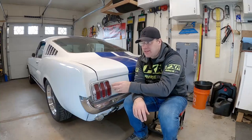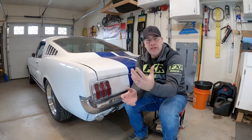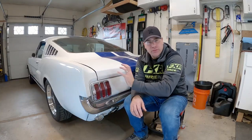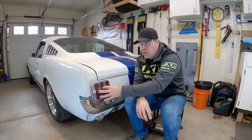It's just a good safety feature to have, and on top of that I bought the style that has the sequential blinking - I'm kind of a nerd, I like that kind of stuff. The LED lights I bought have a switch on there so you can switch between sequential or just regular blinking. We're also going to replace the flasher relay underneath the dash, because the new LED tail lights don't use the same current as the original bulbs.